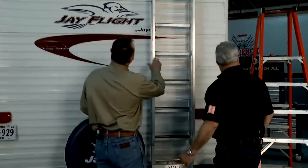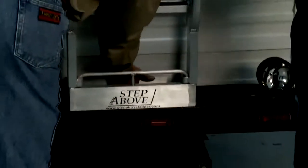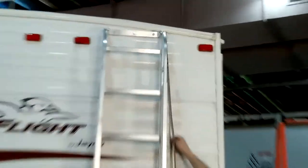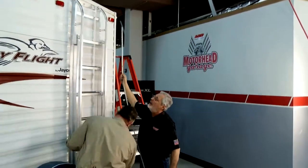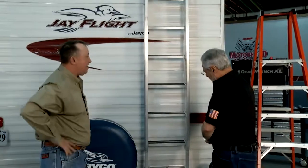Like I said, you want to measure from the top of your ladder, right under your rain lip, to the bottom of your carriage, or the bottom of your body. So you would take a measurement like about here. Yes, sir, that's correct. And get down to here. Bottom of your body, okay. And from the top to the ground. We need 2 measurements, from the top to the bottom of the body, and the top to the ground. So you can figure the angle. So we can figure the angle, that's correct. Because some motorhomes are a little taller than others, and we fight different battles with that.